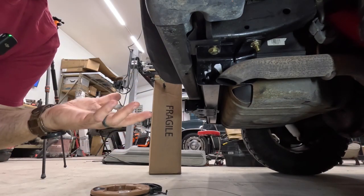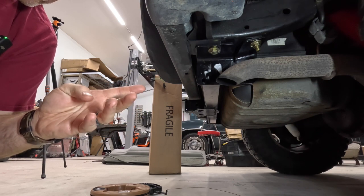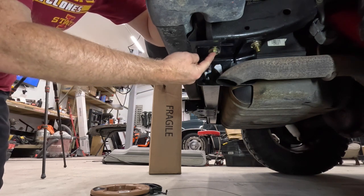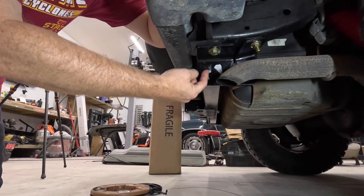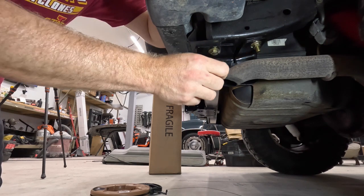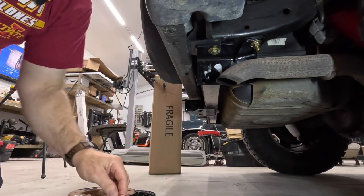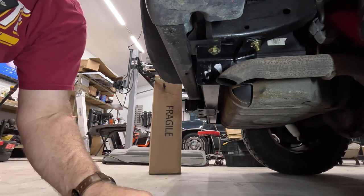Looking underneath the Jeep, I've already installed the hitch — it's right here. It's stupid simple. It comes with four bolts. The two in the far back just go into factory threaded holes that are already in the frame. Over on the driver's side you have to remove the tow hook, then those come out, stick the hitch up there, run the new provided bolts right into the existing nut-zerts. For the back ones it comes with bolts with holders so they don't spin — they're a carriage bolt that goes through holders so you can just rail down on the nut.